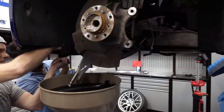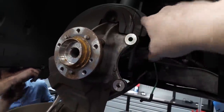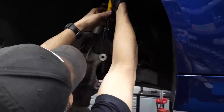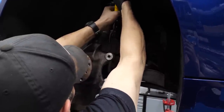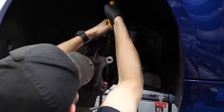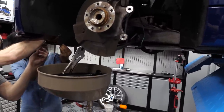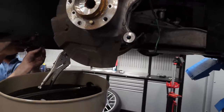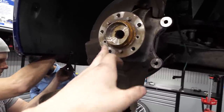All right, so we just cut this off straight right here and carry that directly up in a nice straight line in order to be able to fit the bracket in place. You could use a right angle grinder — I just don't have it here. In a few years I might actually have all my tools without duplication. Yeah, that looks great and clean. I think it's better to cut it straight like that to make room for the caliper. We're going to paint this now.